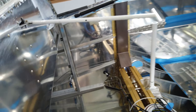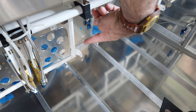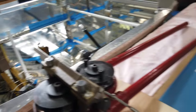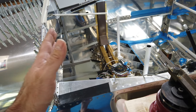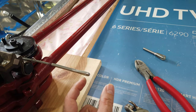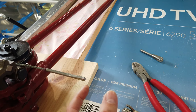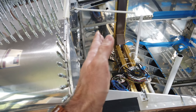That end gets attached to this ear right here on the rudder pedal. When you look at the instructions, the rudder pedals are adjustable fore and aft. So depending on where you end up putting your rudder pedals, you make an extension to attach the cable to that ear, and the length of that extension is dependent on where you have your rudder pedals situated within the cockpit.